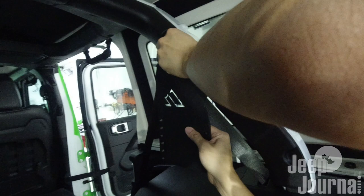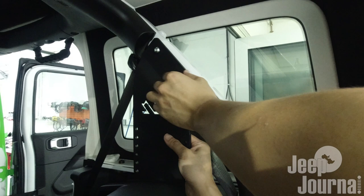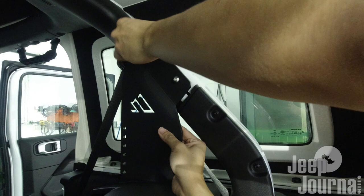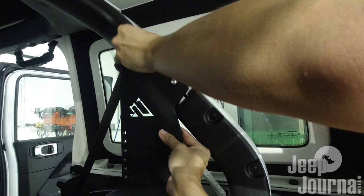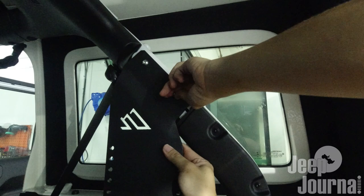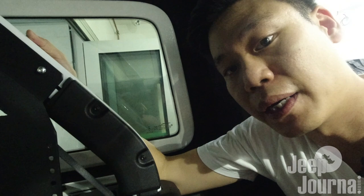Please be careful during this step because this is metal and you don't want to scrape the factory paint on the roll bar. Be very careful when installing this plate. I've got one side in, now going to the other side and screwing in by hand. You can see these bolts are almost in - please do not tighten them fully yet, because before mounting the shelf you want everything to be loose so there's room for adjustments later.